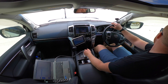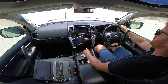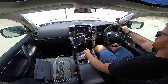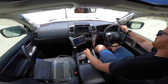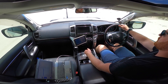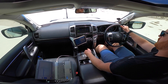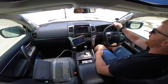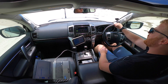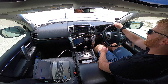It was time to start with our acceleration test in the stock factory setup. With all tests today, I attempted to keep all variables as constant as possible, choosing identical lines in the sand. Tests were conducted one after another — no fans, then repeated immediately after fans were fitted — to avoid any changes in environmental factors. For the acceleration test, the vehicle was stationary for roughly five minutes prior to each test to account for similar heat soak. For the slow speed beach run, we stayed up high on the beach aiming for about 40 kilometres an hour in high range.